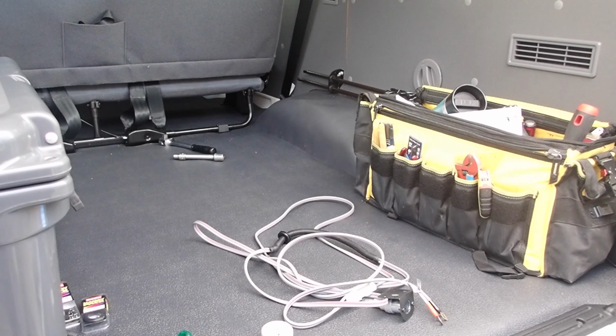Now there's an accessory box on the driver's side of this vehicle that can either provide engine on, power all the time, or ignition on. So it's got three options. So that's the easy target for some wiring. If in the future I go with a dual battery, I'll put the system on the passenger side where the crank battery is. Now, not enough room under the bonnet for a battery. Thank you, overly loud car. The crank battery is on the passenger side of the vehicle, so if I put a dual battery system in, it'll probably be on the passenger side.